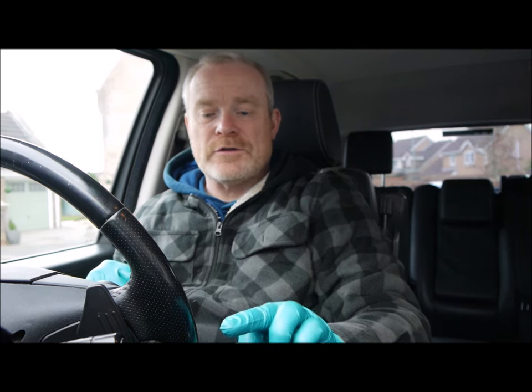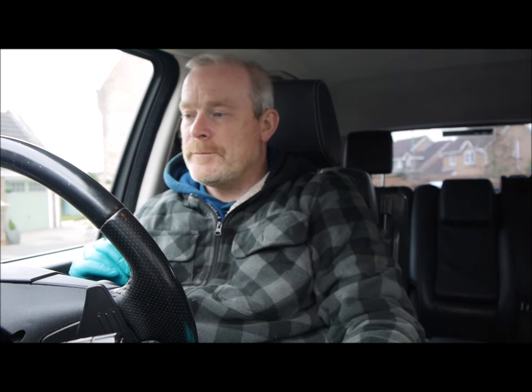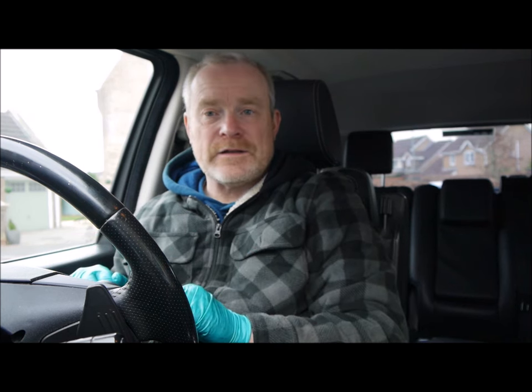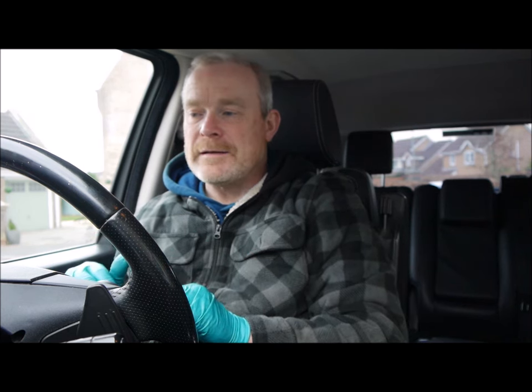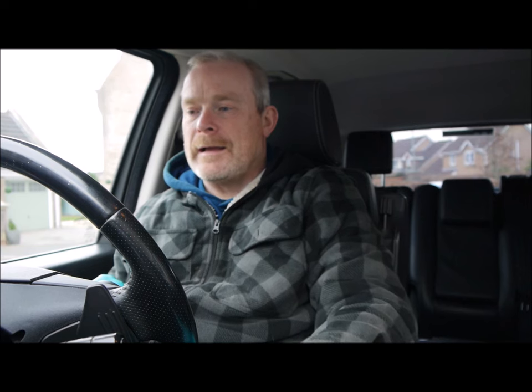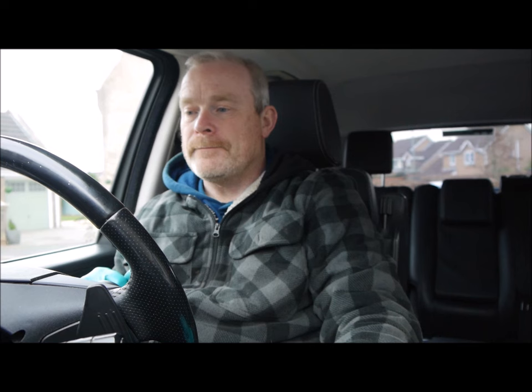Well, that was a combination of opening the bonnet, pressing the start button, opening the driver's door, pressing both pedals until the bing bong finishes, which is your door open, which is a minute, take your feet off the pedal, turn the ignition off, and then start the engine, which we'll do now, and hopefully the service light has gone away. Yes, so there we go.